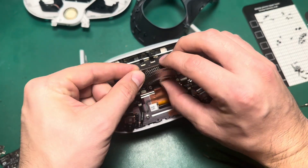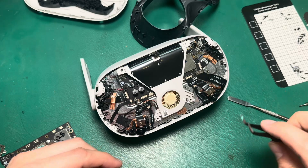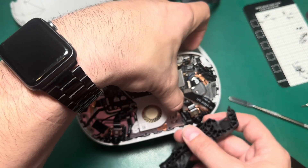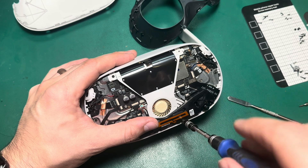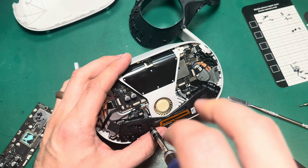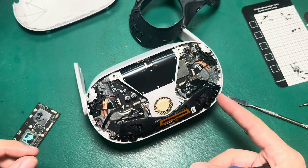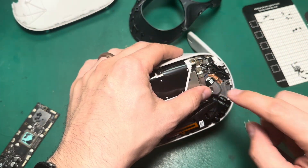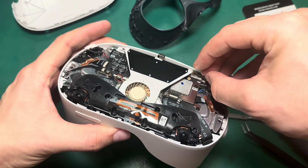We're going to put the heat sink on, and once that's screwed in we can pop the fan back in place. We'll put the one screw at the corner and plug the fan back in. The Bluetooth antenna hooks in right here on this clip and we need to guide it through these little retainers. I like to put the long screws in first, though it doesn't matter what order they go in as long as they all get in there. There are a couple different screws here: the round-top screws with a little blue paint go where the fan is, closer to the inside. The thinner screws with flat tops go into the four spots on the outside. Now we take the retaining bar, hook it underneath the board, sit it on the hex bolt, take two short screws — the slightly longer screw goes at the top — and then clip the Wi-Fi antenna back in.